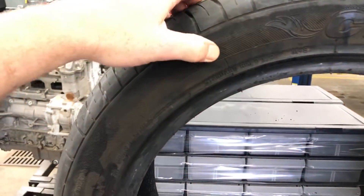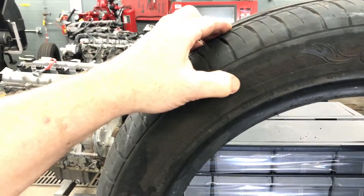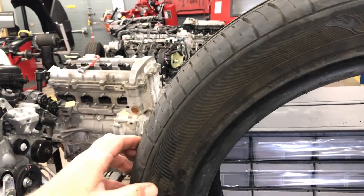So you need to be aware of that — that's always, always, always why you need to make sure your pressure is correct according to the manufacturer specifications or the tire manufacturer specifications. Make sure your tire is at the right pressure, don't ignore that TPMS light, make sure it's working properly, and get yourself a regular pencil tire gauge. You can get digital ones but when you need it and the batteries run out, that doesn't work. Please make sure your tires are at the right inflation. If you see it's low, get it filled. If you see a line or feel a soft spot in the sidewall, take it to a tire shop and get it checked out.